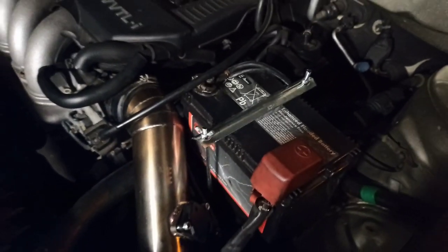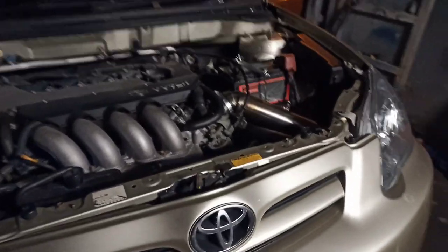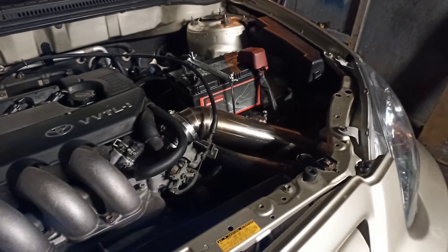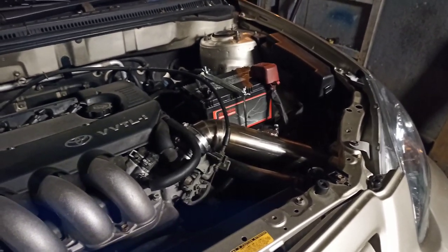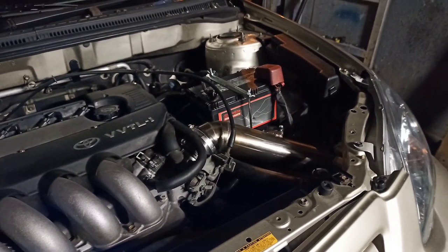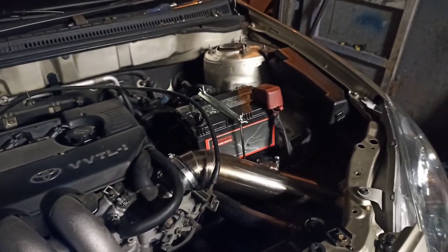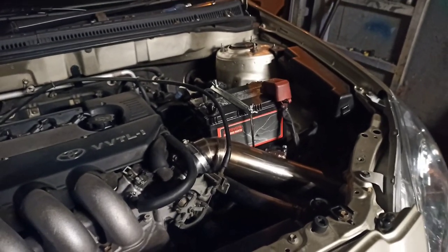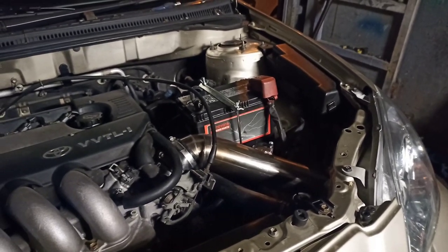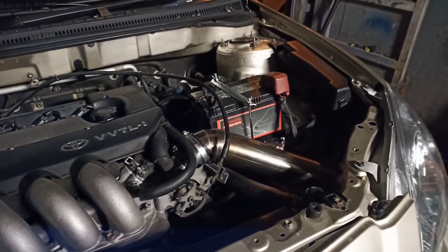Just about the battery relocation, you don't need to do anything. You can use your standard battery bracket. You take it off where it is and you move it to the top. Put the 10mm bolt in there on the mounting, and you just pull it tight. Then you get a piece of rubber or a mat or something, you make a hole in there, so the battery basically goes on top of that, and then you get the universal battery bracket. I bought this at Midas, 25 rand, and it works. You must just swap your battery terminals around from left to right, and then it works. So you can obviously check what works and what doesn't.